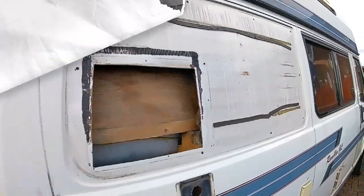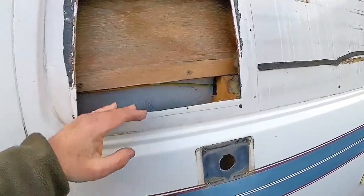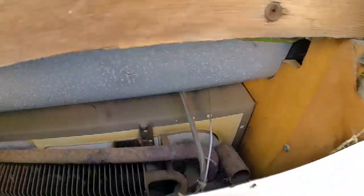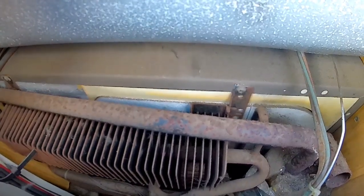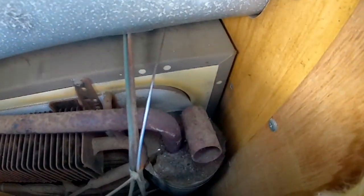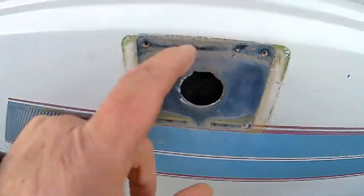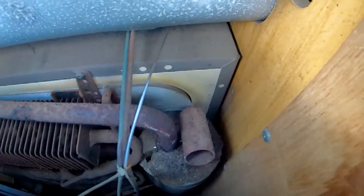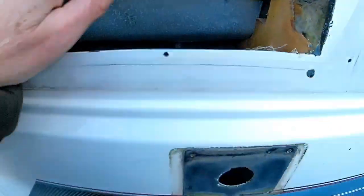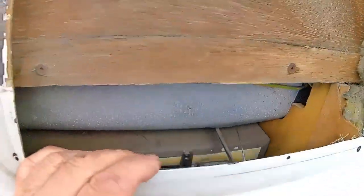On the motor it has a plastic panel on here and this is a vent for the gas fridge. But it's never worked properly and it was dangerous. I realised now why it's dangerous — the exhaust for the fumes from the flame chamber was not connected. Somebody had it apart and not connected it back properly, and it also vents inside, making it very draughty.